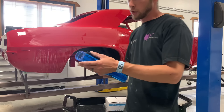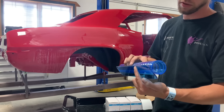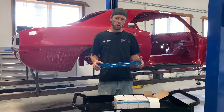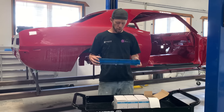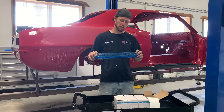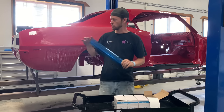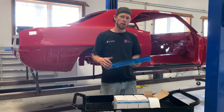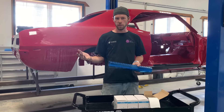Another thing with the linear blocks is everything is CNC cut, CNC routered, and radiused. Linear blocks are available for sticky back and velcro type papers. There are three different flexibilities: rigid, flex, and ultra flex. This is an 18-inch flex right here — slightly flexible for something like this quarter panel. Linear blocks are also available in any length from four inches up to eight feet.